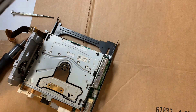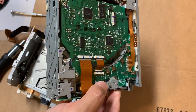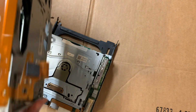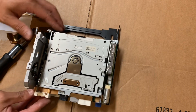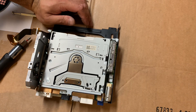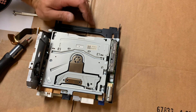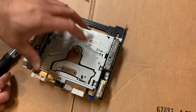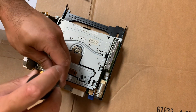There's no problem in this CD changer unit. One of the problems with these units is that if the DVD map drive does not work, or if you don't have a DVD map, it actually does not turn the unit on for some reason. So it's really critical to repair this DVD drive. The next step is there's actually one screw right here to remove the DVD drive.